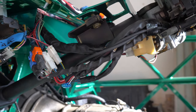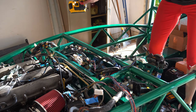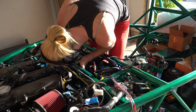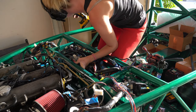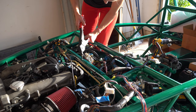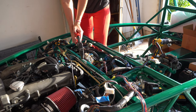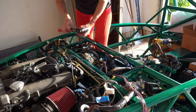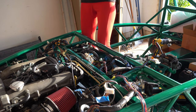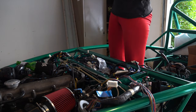Because I had to readjust, after shoving what I could into the tray and some precarious foot placement, I was ready to drill in the wiring tray. Drilling those holes in the aluminum tray was a treat compared to this square tube — this is a much tougher material, so I started with a smaller bit to work my way up. And to top off the struggle, it's time to rivet. I'm going to do this like six more times, at least. Nailed it. That's one. It's in.